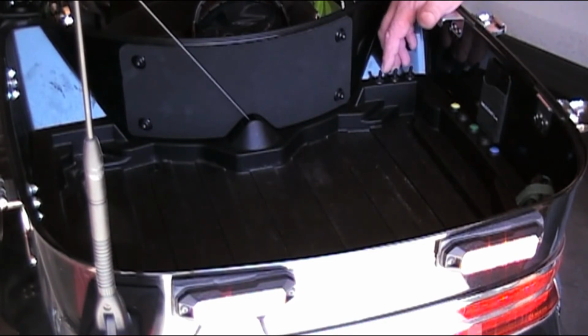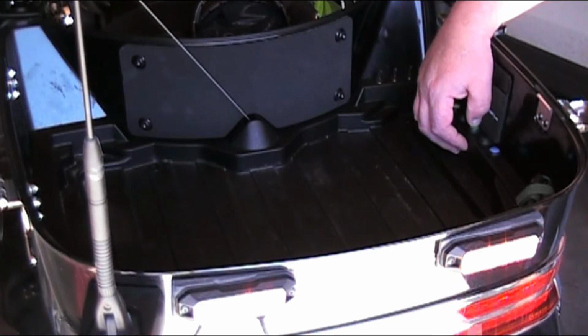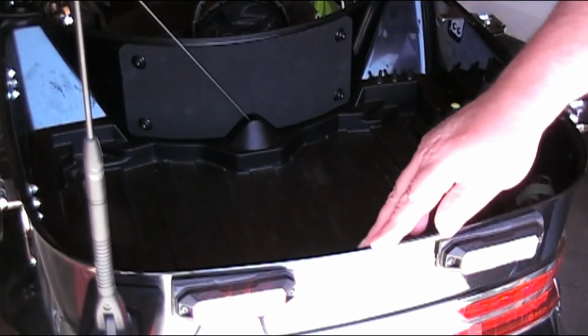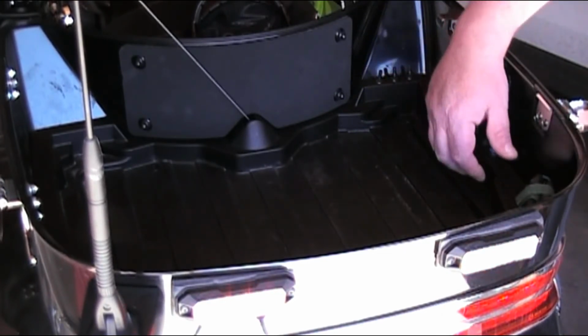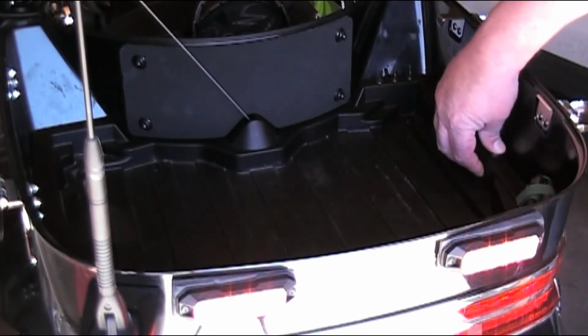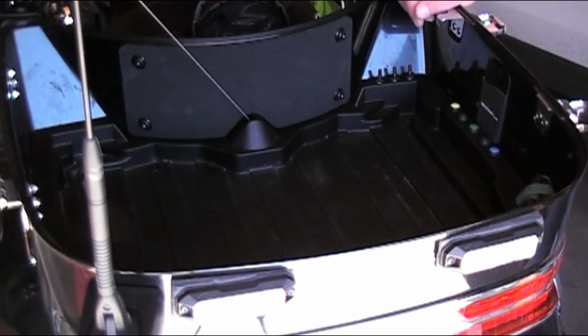These are disconnected. So I'm going to go ahead and push the green button, which is equivalent to the white wire. Push that, 2 seconds. Now they're back in alternating mode. Push everything, these two lower switches, to the fourth position. Now I can change the brightness of both of them, and I can change the pattern. It's bright. Okay. I can turn this off. Now it's off and it won't operate.